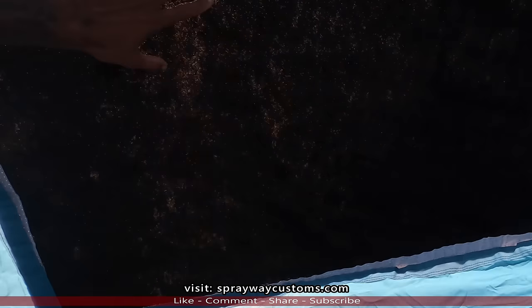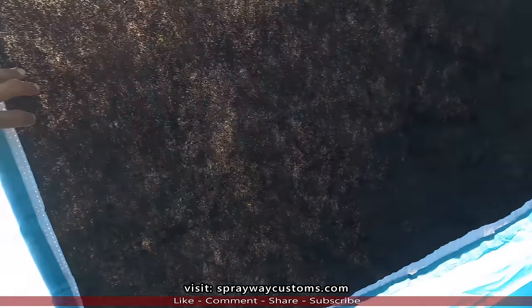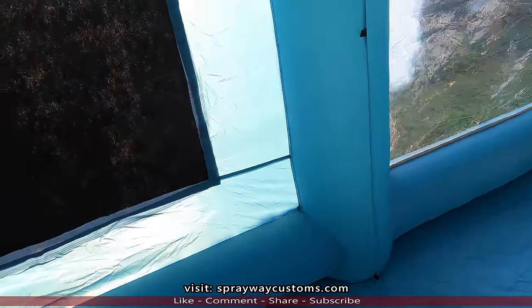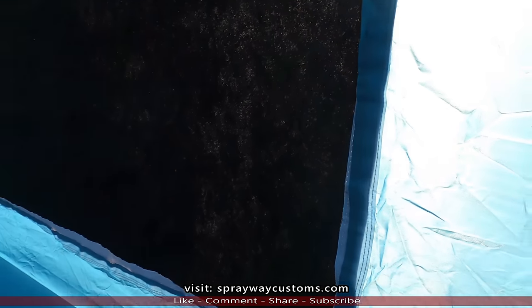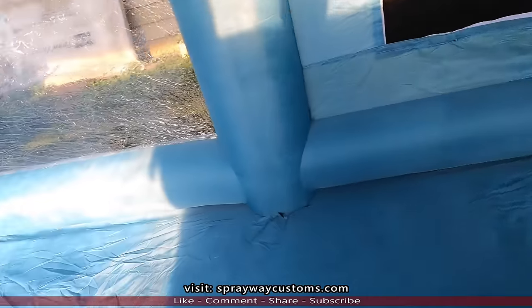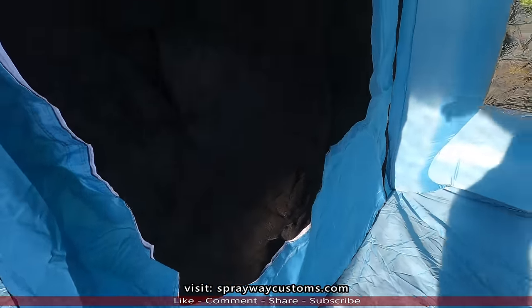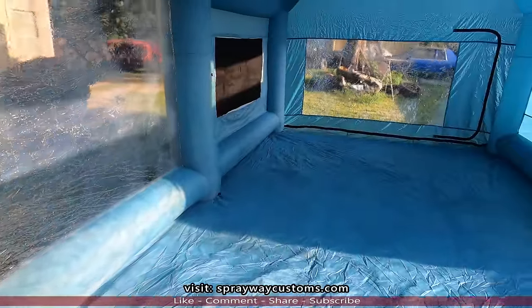I was thinking about putting that, I got like a shop fan. I was thinking about putting it right here to pull some of the overspray out. I don't know how good that's gonna work because I ain't got the other attachments. This is the spray booth coming straight out the box. No upgraded fans or anything. Let me get the car in. We'll see how it's gonna work.